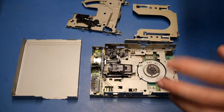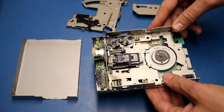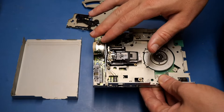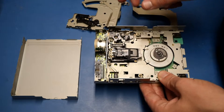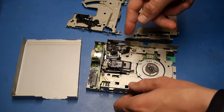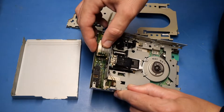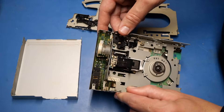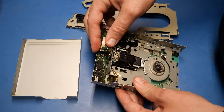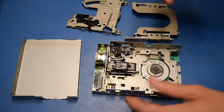I don't recommend taking this drive down further than this minimum disassembly level. Clean as much as you can in here — this little mechanism will come off without a problem. But don't go into removing the stepper motor and the head and stuff like that, because you can end up with alignment issues that are going to cause problems. I didn't think about that until I was reassembling this drive, and so this stepper motor can be tweaked. I'm going to have to see how the drive behaves when I plug it back in, as the head may need aligned with the track on the disc.